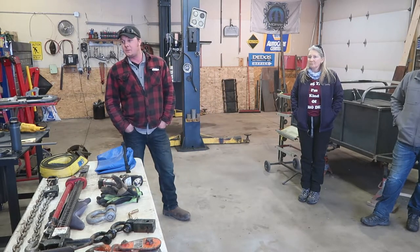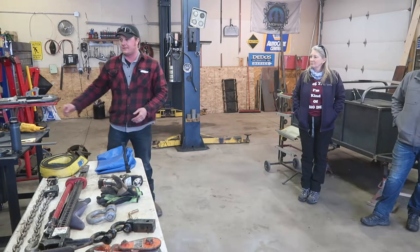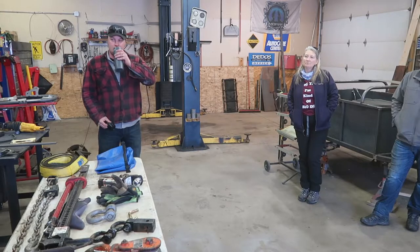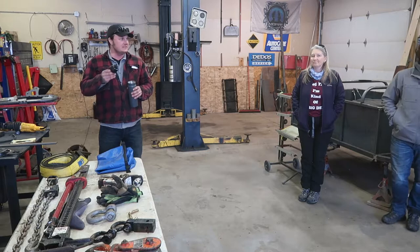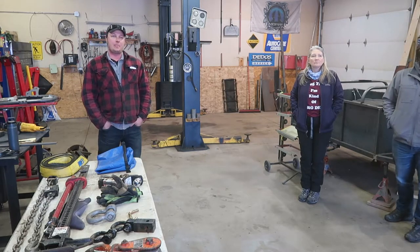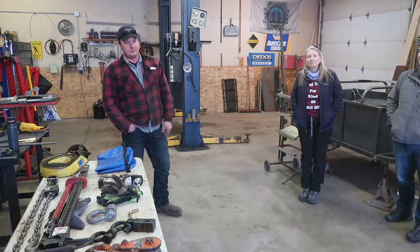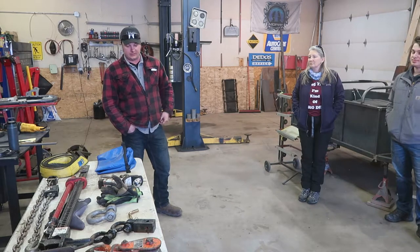With the winches, when you buy a winch, you should really take it out, pull it, and wind it back in under load. With a load, yeah. I think you said like 1,000 pounds. I just pulled my Jeep up my driveway. I hooked it to a tree up by my house. There were a couple people who needed to load their winch, so we can do that today. If you have one, you should be pulling it out at least once a year, if not twice a year, and making sure it works, because we ran into issues with ours. Part of the winch maintenance, I can go over that quick.